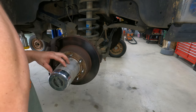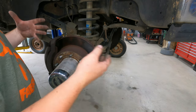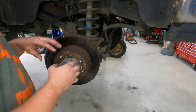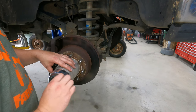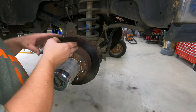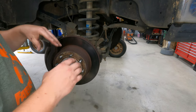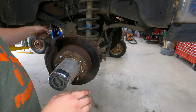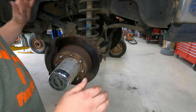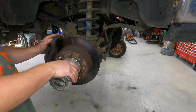This is a free spin kit from Ballistic Fab — there's another company or two that make this as well. It basically takes your modern Dodge sealed bearing hubs and swaps them out for the old-style tapered bearing hubs, so you have packable, greasable bearings and an actual locking and unlockable hub. From the factory, these things have a unit bearing — a sealed bearing — and it basically spins all the front end components all the time. So you have your axle shaft spinning, connected to the differential, your front driveline is spinning. If you add this kit, it stops all that stuff from spinning all the time.